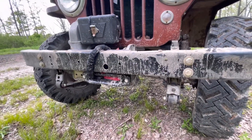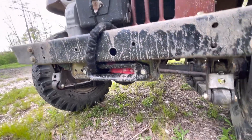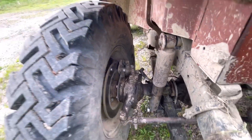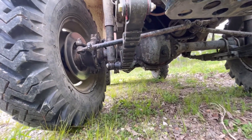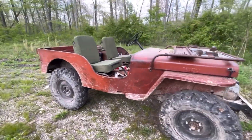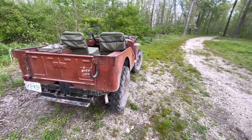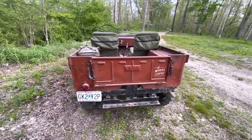Done an 8274 winch I picked up used — this is a Brennan's Garage mount that we welded on. We also got the Brennan's Garage disc brakes in the front and the Big Willy high-clearance spring plates in the front. I've got them for the back but haven't got them put on yet. We've also got the five-to-one gears for the transfer case, though we haven't got the transfer case in yet. I picked it up from Jeff Petrowich up in Illinois — super great guy. I'm anxious to get that in there one of these days.